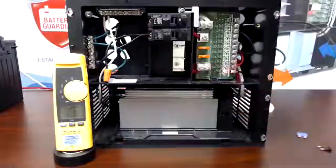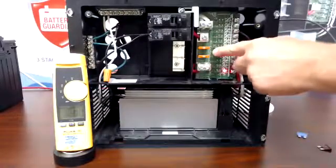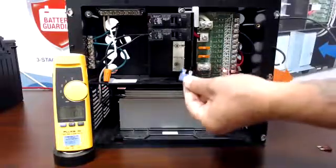What you need to do is cut all power off to the coach, then use a pair of needle nose pliers to crimp these down just a little bit more so it's holding the blades of the fuse more securely and not allowing it to heat up.